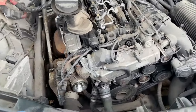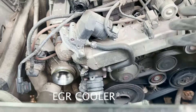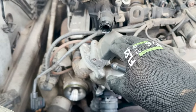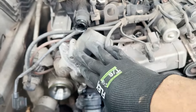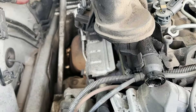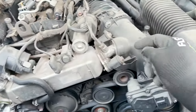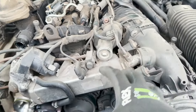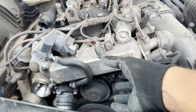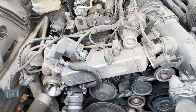Now what we need to do next — this is the body of the EGR, and right there you have the EGR valve sitting right here. I'll go ahead and first remove the valve itself, and then we'll be able to undo some torque screws over there, those two screws here, and another one here, in order to take out the EGR cooler.